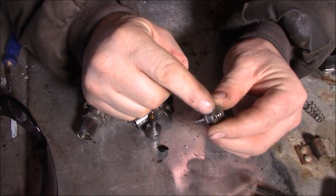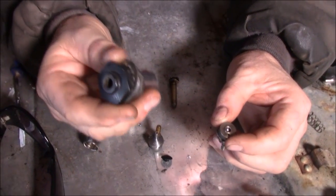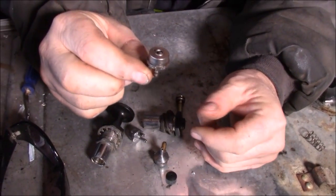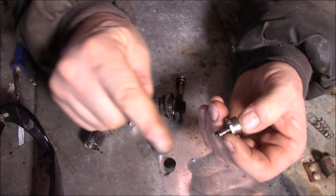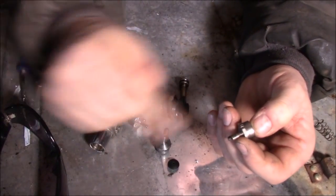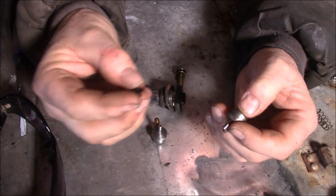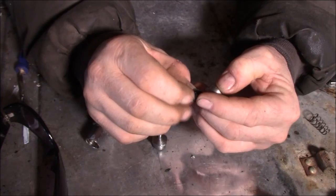So if you're messing around with a snowmobile and it's flooding all the time with one of these primers on it, and you've messed with a carburetor, you've messed with a lot of things and it's still flooding, check your primer out. Look in your lines and see if you can see the fuel coming through here and coming around again, because it may be drawing it right in the back of the carburetor. Usually the problem is these here get too hard or they rip right here.